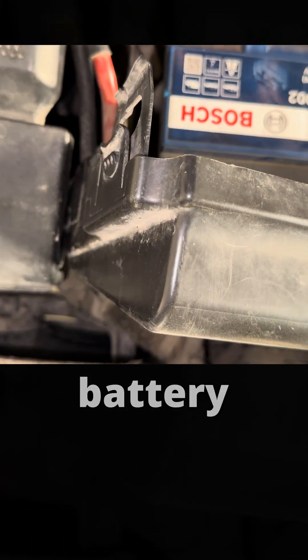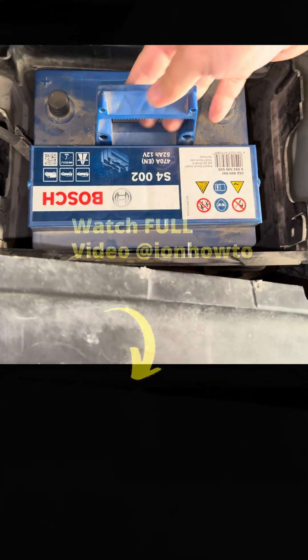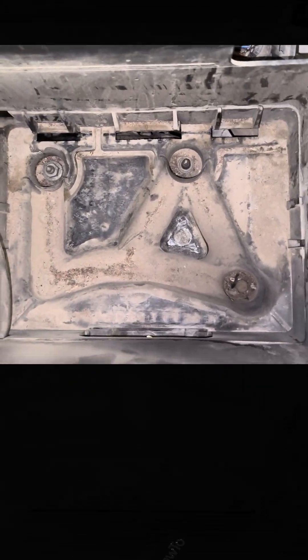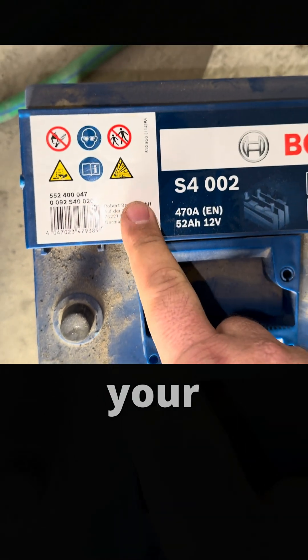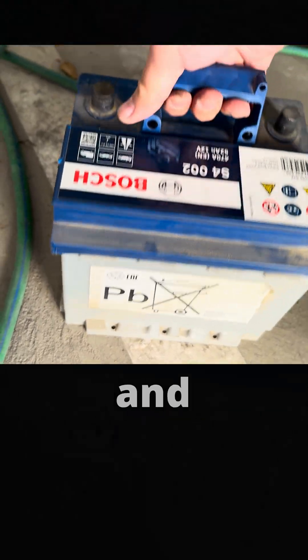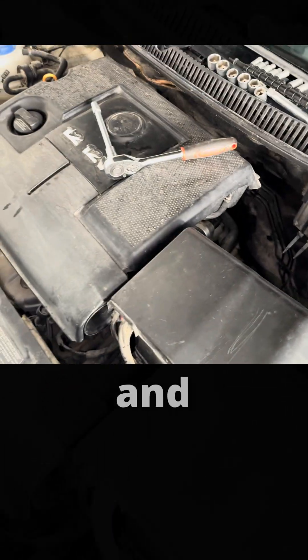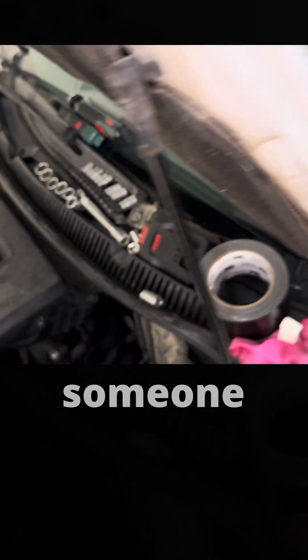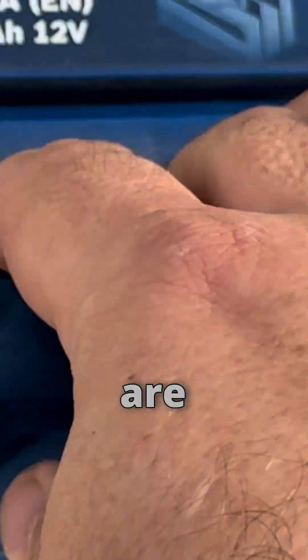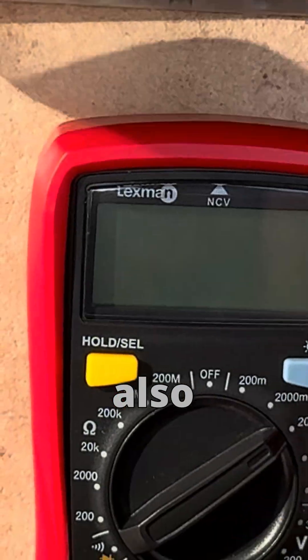Now I can lift the battery and go charge it with the charger. Make sure you read all the warnings on your car battery and take them seriously — it's corrosive, and there is sulfuric acid and lead inside, two things that are not great. When you're done with the battery, recycle it; take it to someone who recycles them. They are very recyclable — the lead and the acid inside are both valuable.